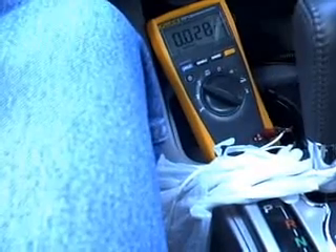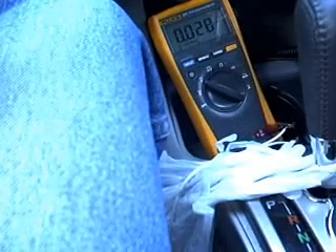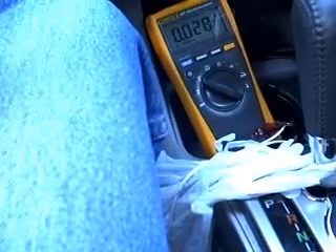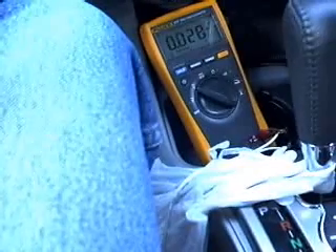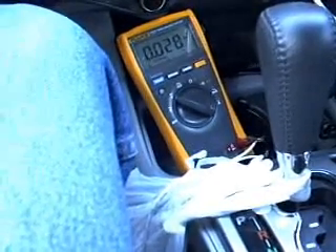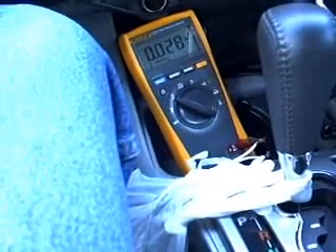Given the fact that my production values are varying this widely, taking that into consideration, I am observing an increase in gas mileage right now with HHO alone of approximately 12%. I've gone from 16 and a half miles per gallon average to 18 and a half miles per gallon average.